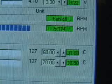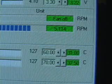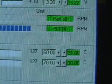Now let's look at some temperature results from this cooler. The temperature is 38 degrees Celsius at max load — certainly some fantastic results. This cooler keeps the temperature very low, which is especially important if you're going to be overclocking your Pentium 4 CPU. I have a Pentium 4 1.6a running at 2.4 GHz with the voltage at 1.5 volts, and the temperature results are great.